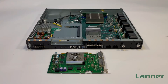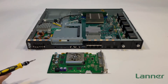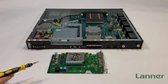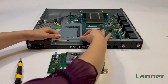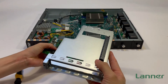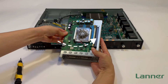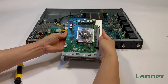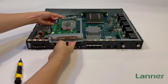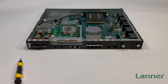Let's explore the extendable capabilities of ECA4027. The ECA4027 comes with an optional PCIe expansion slot for graphics or accelerator cards. To install a graphics card, you first remove the screws on the bracket, and then you simply lift up the bracket gently. Then you also lift up the graphics card and gently slide it in. Make sure the pins are aligned, and then slowly slide it in firmly. Next, you simply put the bracket back in, watch out for the sockets on the bottom, and there you go.